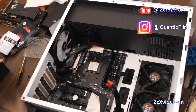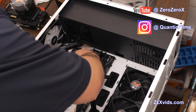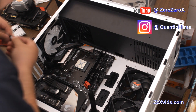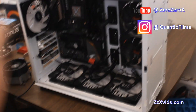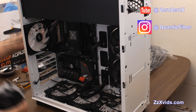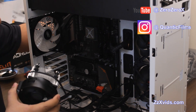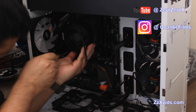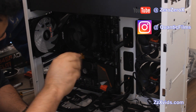Now we're putting thermal paste. We ran out of thermal paste, so in the middle of the build we have to clean it again and install new thermal paste. We opted for doing both the X and the dots — we made the X and then added a little bit in the middle for the best cooling possible. Now we're about to install the stock cooler that comes with the AMD processor. It's a very decent cooler and it proves to keep the CPU under normal temperatures. I don't need an aftermarket cooler because I'm not technically overclocking it, so it will do just fine with the video and audio production.